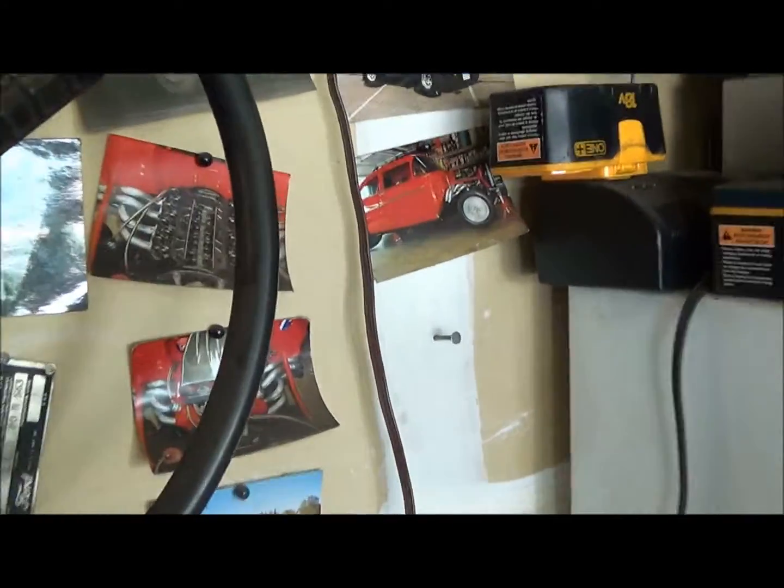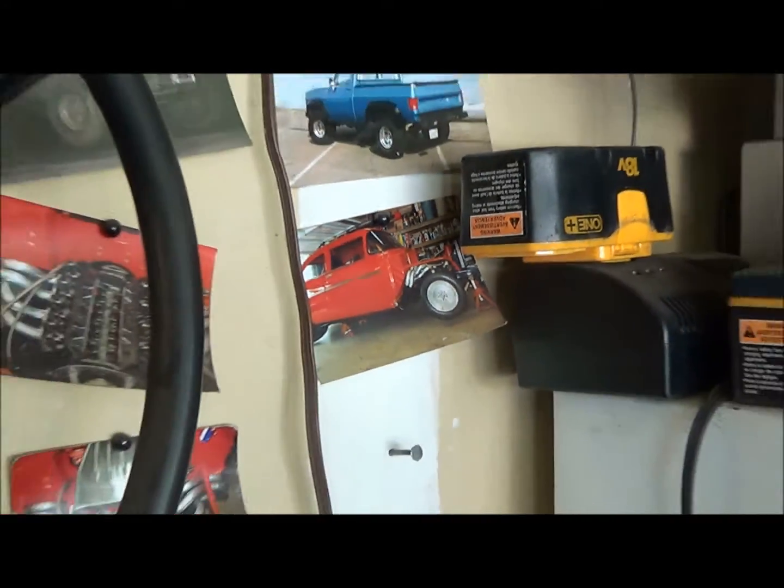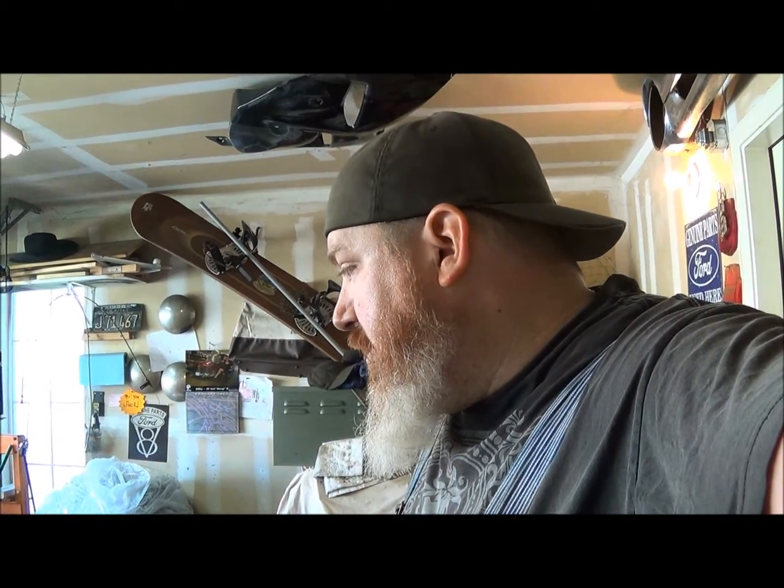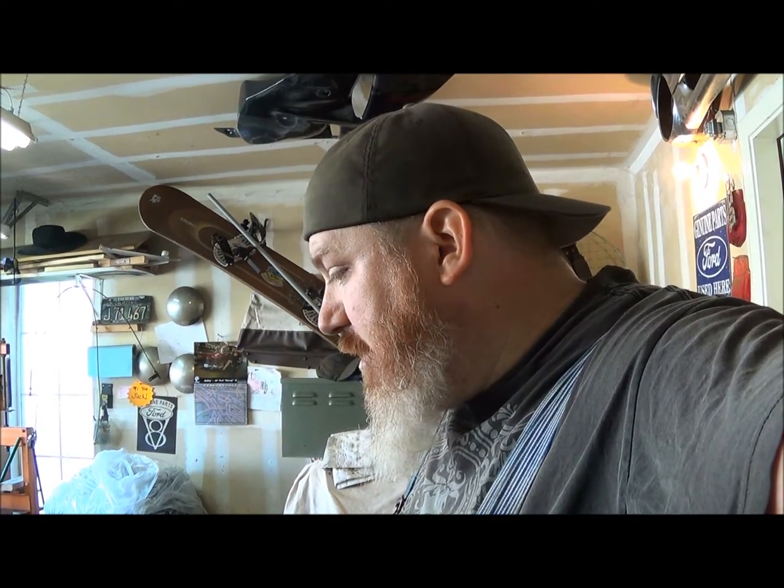What I may end up doing is picking up a drive shaft hoop that I can put in there and weld, and then the drive shaft can move up and down in it as it pleases. I kind of like that idea. Then if the drive shaft ever lets loose, it's good. We had to run one in here, of course, for racing. That of course had a heavy duty drive shaft loop in it. Never interfered with it. So I think that's what I'm going to do. I'm going to search around for that, see what I can find. I could also build one if I needed to, but I prefer to just pick one up. They have some nice round ones that aren't very expensive, even if I get two of them and weld them together so it's the same width as the cross member.